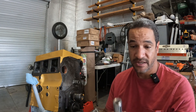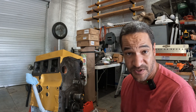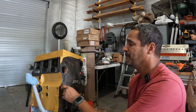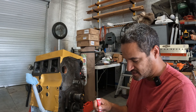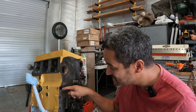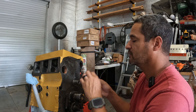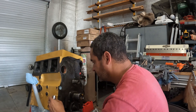I just got a socket that fits inside and I'm going to put some Loctite on this thing. If this one were to leak or come out, it's in a bad spot — it's going to be under a plate that goes right here. I can't continue until I get this plug in to put the plate in, to start putting the camshaft, pulleys, and other items. I can't put lifters in, can't put pushrods in — can't do anything else until this plug gets in. Hopefully it's going to work. Beautiful — it's in.